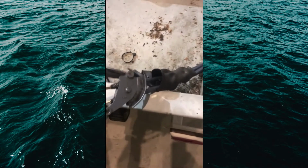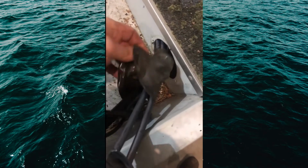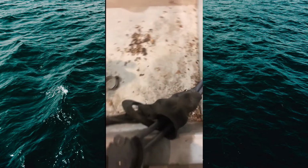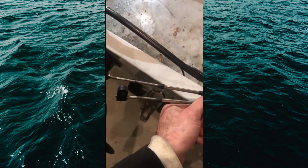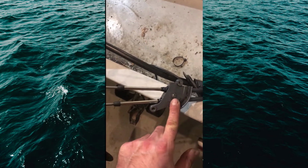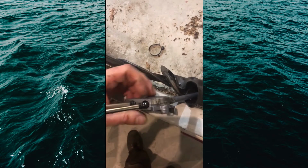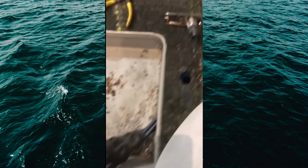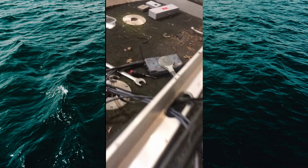The thing I ran into real quick though is I'd love to save this sheer rubber boot, because these are good to have. I flipped them inside out and pulled some of the stuff through there, but I left this bracket on here for the controls, and I'm going to have to go ahead and split that. I just have to undo that one bolt, and it comes apart in 2 pieces, and set that aside for now. Then these can get sent all the way through here, and the control box can get out of the way.